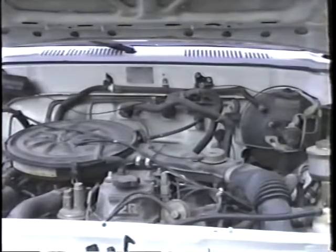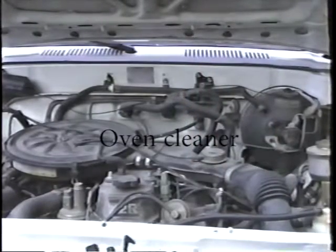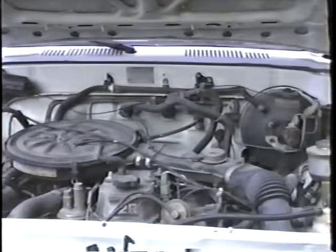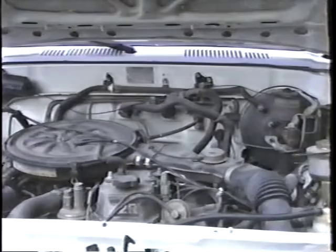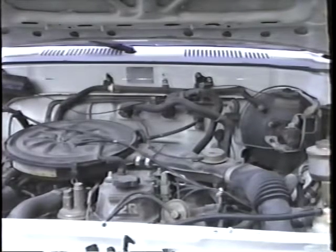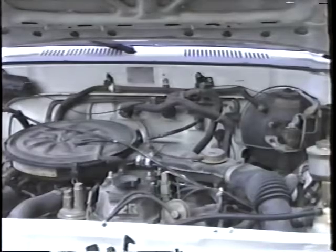To start off for cleaning the motor, you have an oven cleaner you can use to help get the grease off. The motor doesn't have to be hot, but it does clean better if it is warmed up some — though you can clean it while it's cold. Make sure not to spray this oven cleaner anywhere near the alternator, any kind of electrical equipment, electronic ignition, or any kind of rubber. Read the instructions on the can and then spray a little foam on the heavy, greasy, oily places.